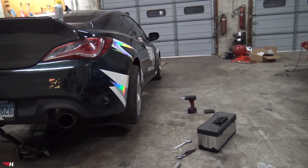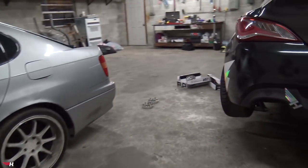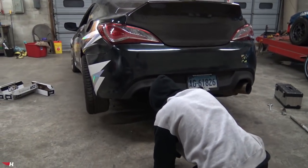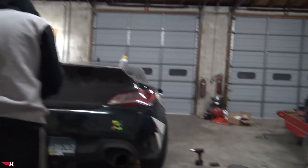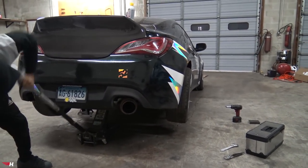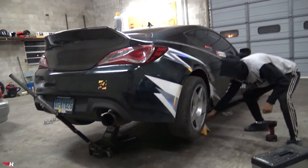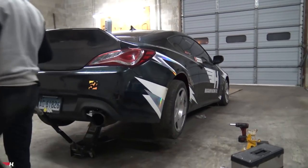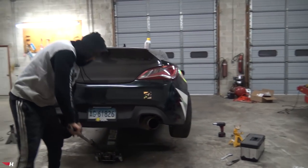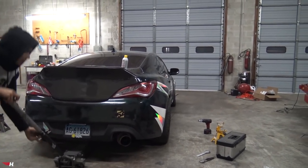It looks so funny. It has positive camber and massive toe-in. They both have toe-in. I might be able to pull it out with a stock lower control arm adjustment. Let's see what it's like on the ground. It looks so wrong. No, it looks broken. But the car is so pretty, but it looks so wrong. All right, this is it. We're about to see what this looks like. Horrible alignment, buddy. Ready? Ew!